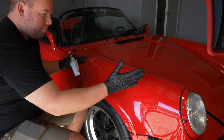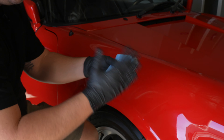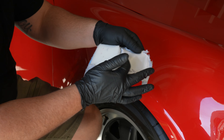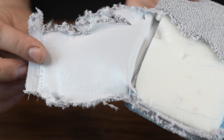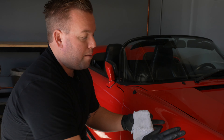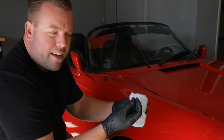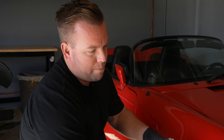I've obviously prepped it properly. The second thing you're going to want to use is this applicator — this one's from Autofiber. I hate the suede things that go over the block, and I love this applicator. This is called the Saver applicator because it has a plastic lining on the inside. Why is that important? Because you're going to have more of the product stay on the surface of the applicator, which means you're going to use less product. As your applicator becomes more primed, the spreadability of the product is going to be much more even, and you're going to be able to work bigger panels. You won't have it absorbing into the applicator, which is essentially losing you money — hence the name Saver applicator.